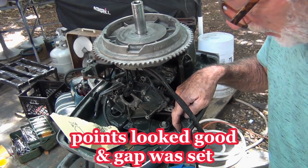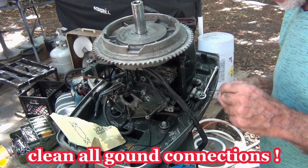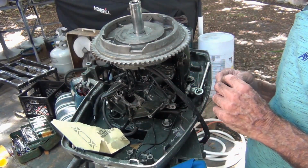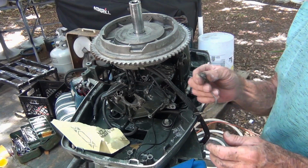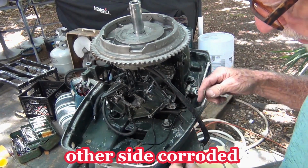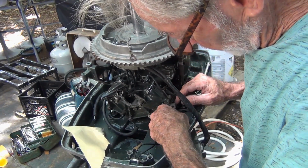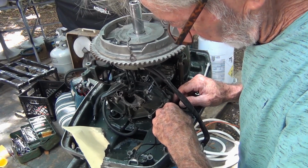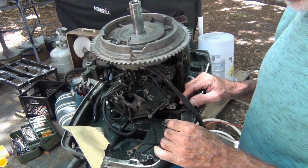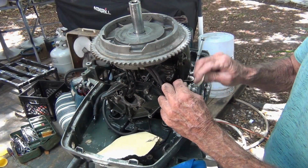Alright. Anyway, there's paint on there. This little star washer is barely making contact through there, touching the paint, or through the paint, touching the aluminum. Where's that sandpaper at? This side's pretty clean. Right under my nose. See if I can get a little better contact surface here. It should be contacting right with the threads, but we'll do this. Oh yeah, baby. Let's clean this puppy off.